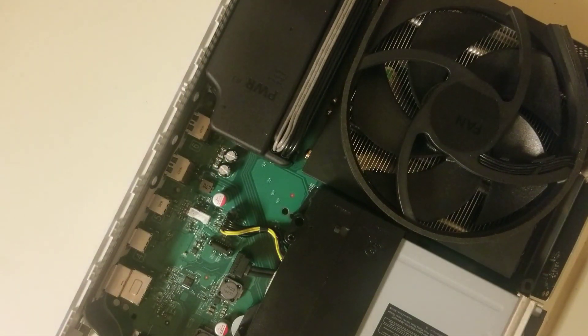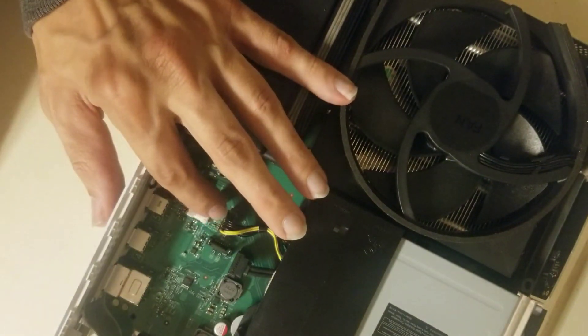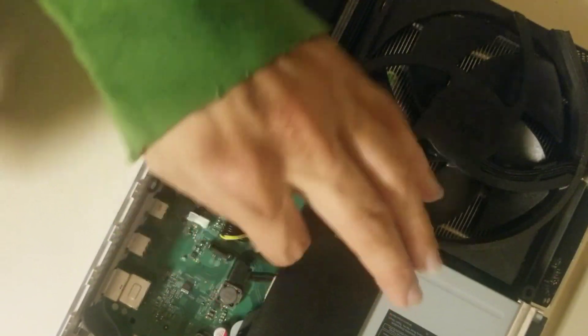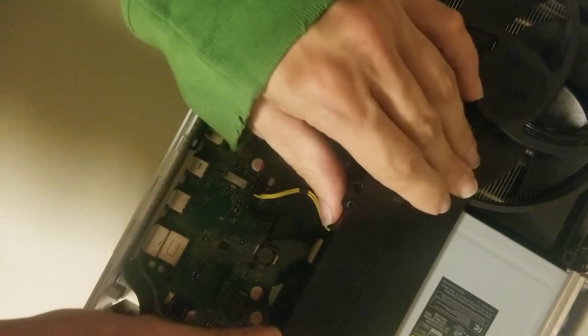As long as you're not pulling it out of there a dozen times, the cables hold up fine. The drive actually has even thicker cable — probably one gauge higher than even the hard drive — and that's also another one that's safe to yank on a little bit by its cables. We've got pretty good connectors in there. You could also use pliers to grab the plastic and yank up if you're worried about it. We'll pull both the connectors — SATA and power cable — loose for this one too. So now we've got the disc drive out.